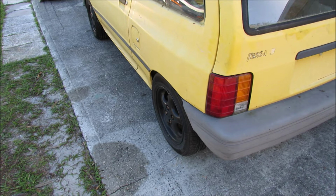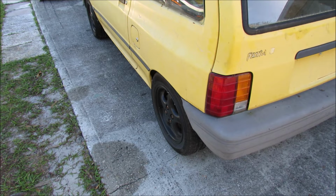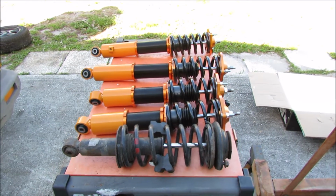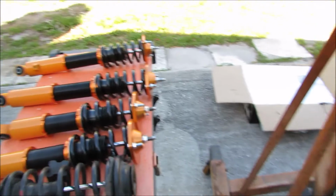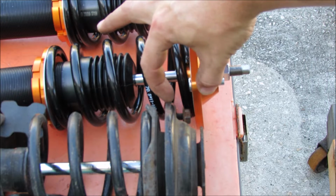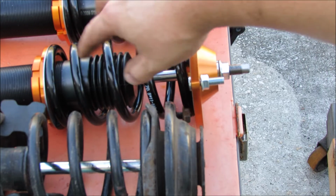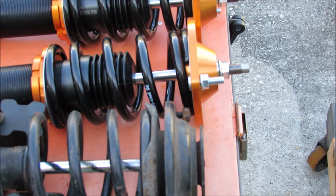So I'm going to loosen the lug nuts, jack up the car, take the wheel off, support the car properly, and then remove the strut assembly. Here we have the old rear strut assembly out, but as you can see, hopefully, at least I do with my trained eye, that's a joke, we're already starting this much higher with the new strut assembly. So that's a very good sign. And we do still have a couple threads we can go up with on the spring mount side. I guess let's get back to reinstalling.